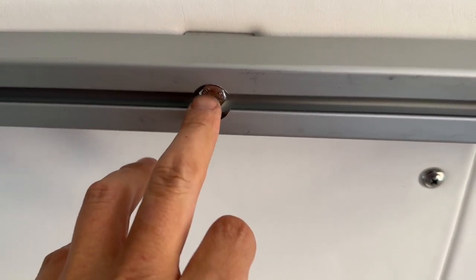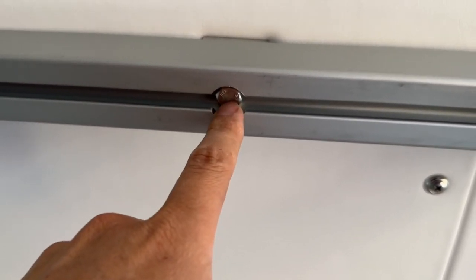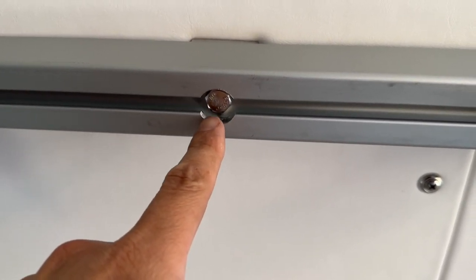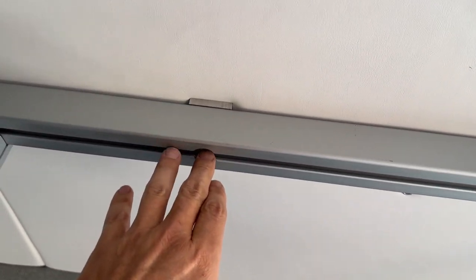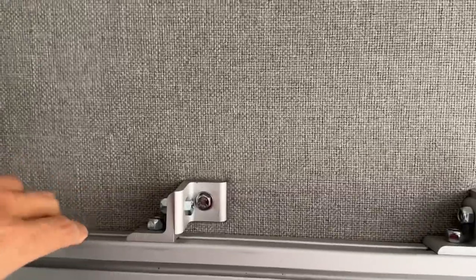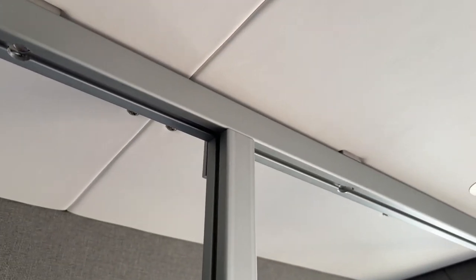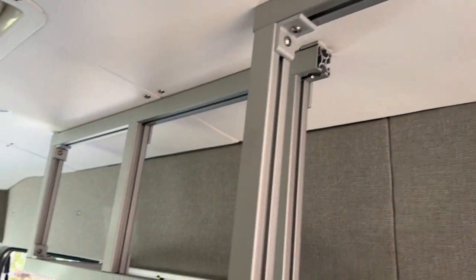This technique is quite a bit more difficult in terms of machining. I had to drill a hole through the 80/20 and then drill a larger hole — not only to be able to get the bolt up through (I used hex heads; you could use a hex head Allen, which might make it a little simpler), but I also made it a bit larger so I could get a socket in there as well. If you're doing this, you need to be precise on where these holes are going to be, whereas with the angle bracket technique it can slide back and forth and you don't have to be very precise. I didn't realize this when I was putting in my plus nuts, otherwise I might have moved things in a little bit further to accommodate for the light and used angle brackets all around.